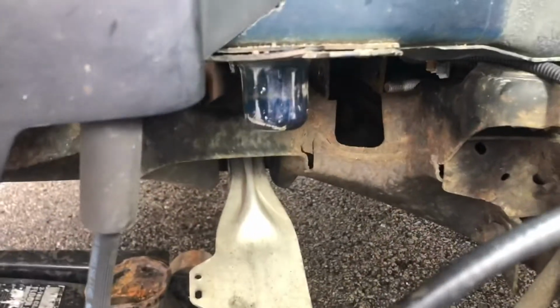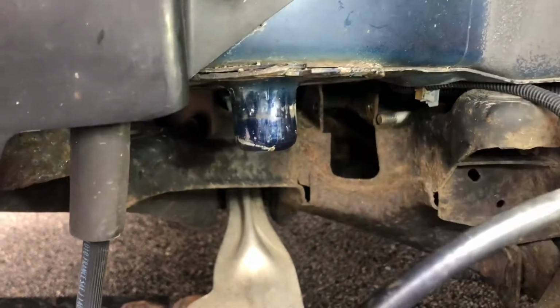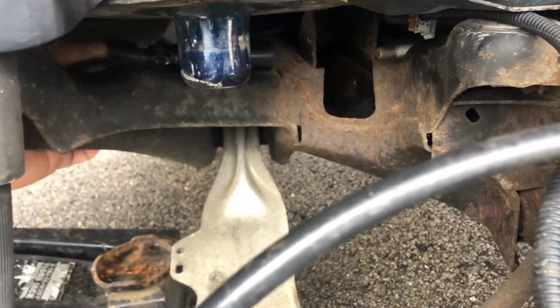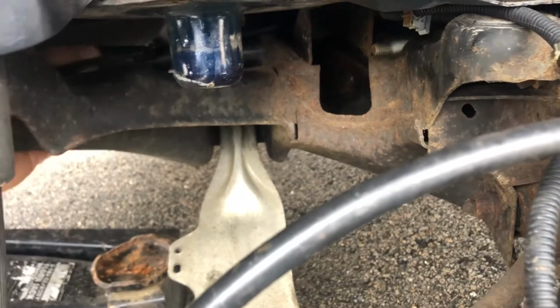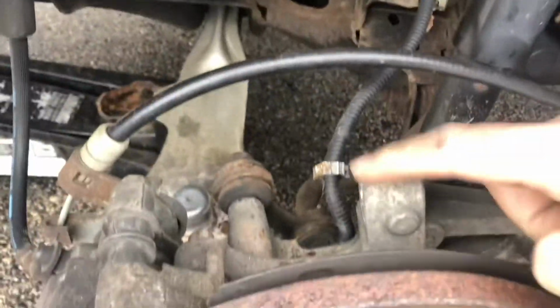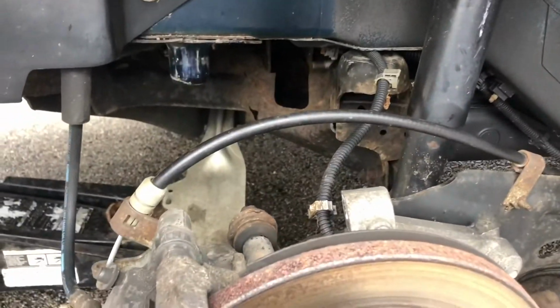All right, we're back again. As you can see, that back there is an 18mm bolt. I was able to get an impact with the swivel back through here to get that nut. See the socket right there by the spring mount. And I was able to put a wrench back there and put the impact on it and zip it off. 21's up here, and then here's the old rusted one. There's a better look of it. Not much left of it.